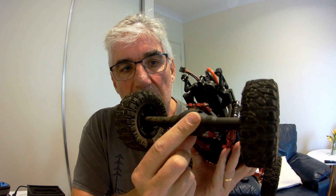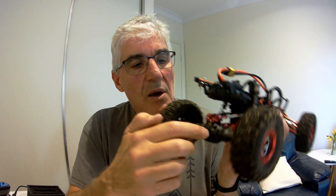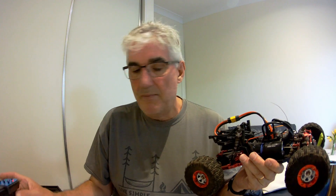After thinking for a while, I realized I needed to disassemble the rear diff and the front diff and swap the gear over, so that when the motor turned one way the wheels would turn the opposite direction. That was easy enough to do. There's a tiny plastic tab designed for locating the diff the right way — I had to grind that off with my Dremel, one in the front diff and one in the rear diff. Now it's ready to test. There's one more little issue: I had to press the power button on the ESC, and once I've got everything back on I'm not sure how I'll reach it — I might put a small hole in the side.